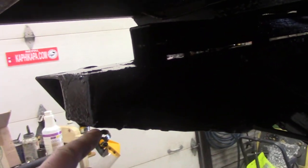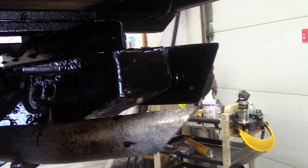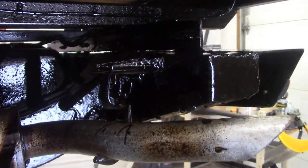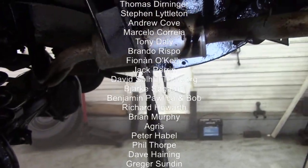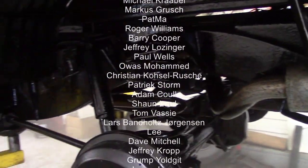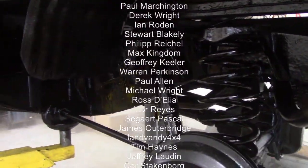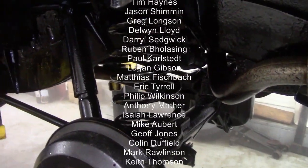Oh, one thing I noticed, I should have told you. Now if you can see, let's go and have a look at the other side because it's in a bit brighter light. On the back cross members, I always box them in now because you're never going to put grab handles or anything like that on. It's a waste of time. So I just box them in to stop all the dirt getting up there. And of course with those mudguards, it's not going to get anything chucked up. But it's always just in case, you never know. When I started this project, I didn't know what it was going to be like. So that's that. So have a look at the car outside and we'll see you later.